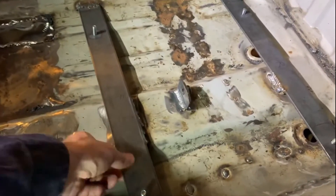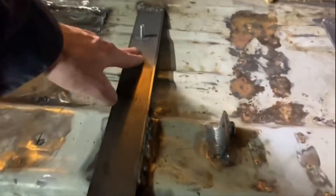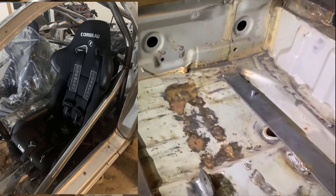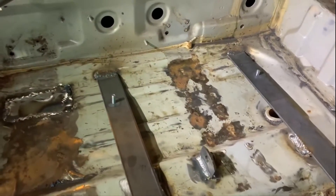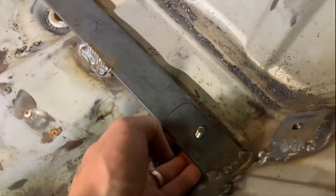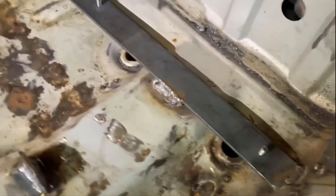This is a three-eighth inch steel bar, and there's steel at the midpoints here to support it so it's got no flex to it. It's secured to the floor pan, and I'm making sure the floor pan is secure to the side frame rail. The reason I did that is because of the height I was trying to achieve - attaching it to the rails would have put it up higher. These bolts here are welded on the back side, which was going to be a pain to hold still every time I was bolting in the seat.